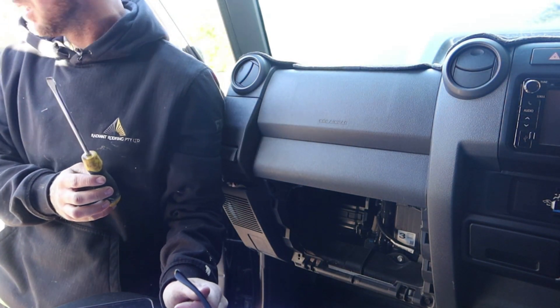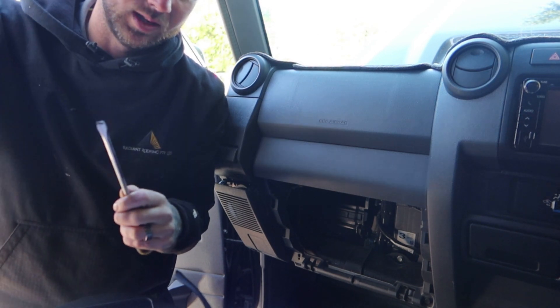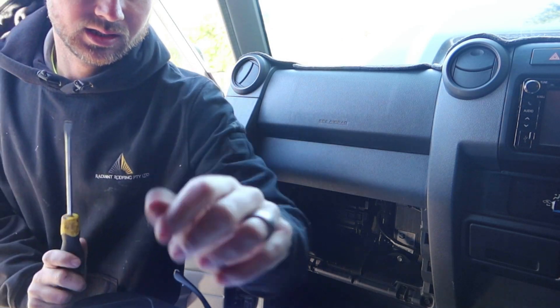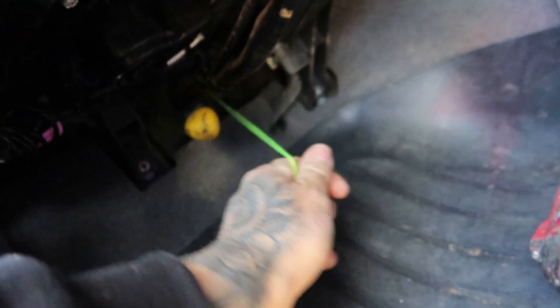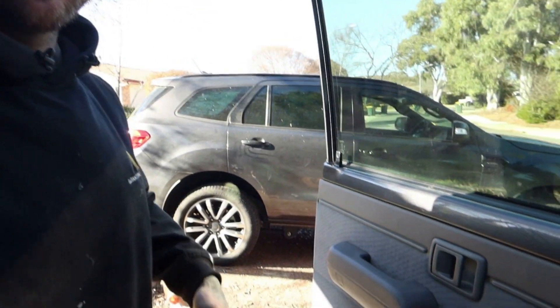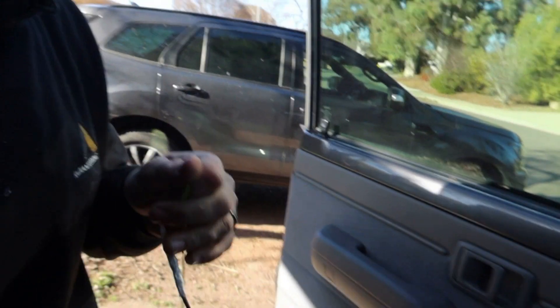To get through the firewall, I'm going to poke a screwdriver through it. I don't have a snake, so I'm going to tape string line to it, pull a couple of meters of string line out, tape the wire to that, then pull the string line back through — the string line is nice and skinny. I taped the string line to my screwdriver, pulled that through, then taped this cord to it. As you can see, I've pulled it through — I'll give you a run-through on where I've got all my cables running.